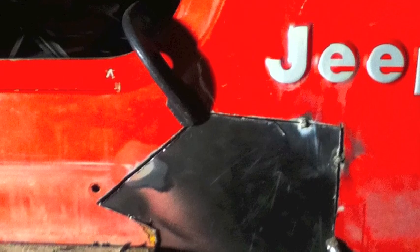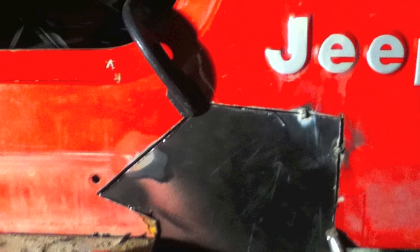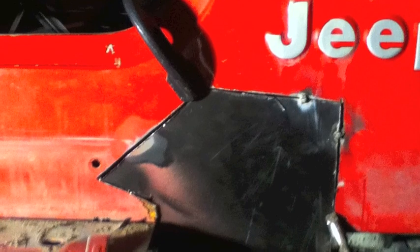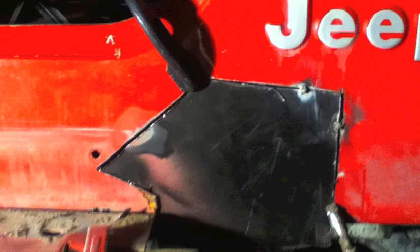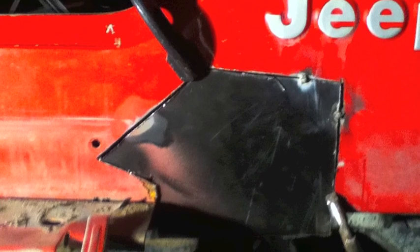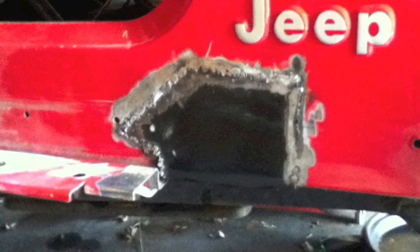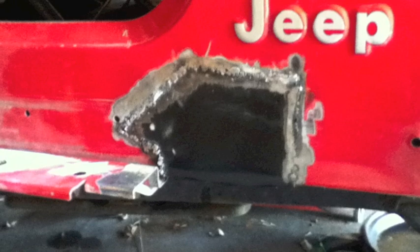This is my patch panel. The first thing you want to do is start by reinforcing that rocker panel — you want to work in sections. Fix the rocker panel first, get it all solid and rust free, and then go about fixing the floor. You start by cutting out your patch panel and welding it in. I've got it clamped so it's not moving so I can tack it. When you're welding sheet metal like this, you need to take your time, otherwise you're going to warp it. Do little spot welds a few inches apart and you should be fine.